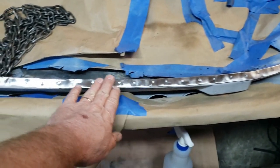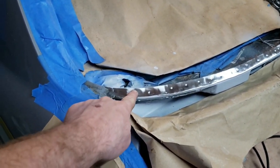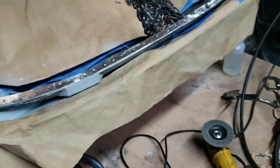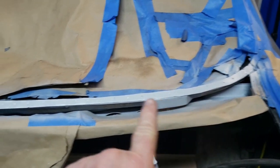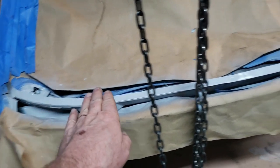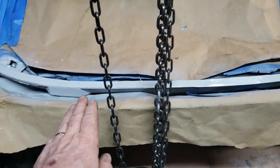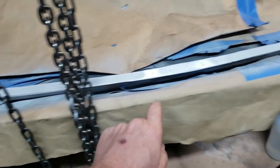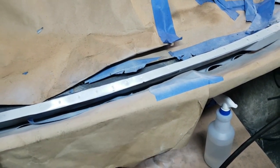I got my spot welds ground down with the little die grinder there — just wanted to clean them up before we put some weld through primer on that to cover the metal and protect it. I got this end down here trimmed down — it was poking up a little bit. Got it butt welded here. Still need to make the patch here, but I'm going to go ahead and put some weld through primer on this thing to go ahead and protect the metal. Looks a fair sight better than it did when we first started. We've got our weld through primer — got two coats applied on there, and that's looking pretty good. Next step will be to put that patch in, and then once I'm done with that, we'll be done with the top, and I'll move on to the bottom part. One thing to note — you can tell where you went a little too deeply with the spot welder; you can see it went nearly all the way through the metal there. But 95% of them were spot on, you might say. Pardon the pun.